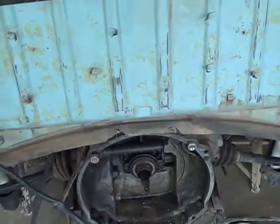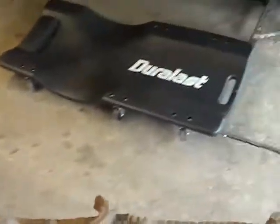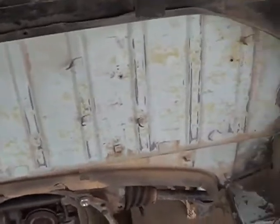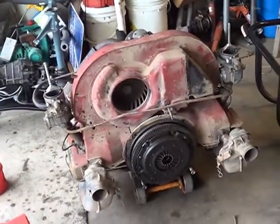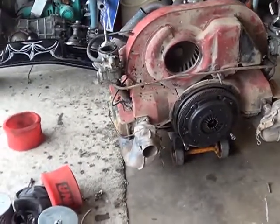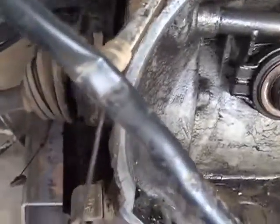I'm going to go ahead and probably yank this transmission. I've got to clean up all this glue. There's this tarboard — I don't know if some of you are familiar with it. It's just for sound deadening; it's tarboard and it goes up here on your firewall. What happens on these older cars after years of sun, abuse, and getting wet is it moves this direction — starts coming out. I couldn't get my hand in here. These little hooks lose their grip, the tarboard gets deformed, and the fan — it's unbelievable how much air goes through that fan — it starts sucking the tarboard towards it. So I couldn't get my hand down there to get the top engine bolt to remove it, so I'm going to have to clean all this stuff up.